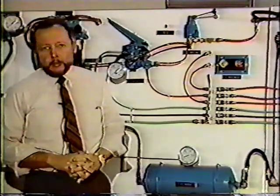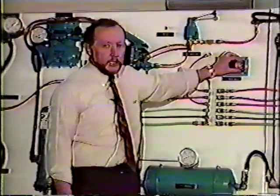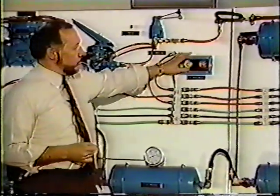That finishes the truck or school bus portion of the program. To turn this vehicle here now into a tractor, as far as the air brake system is concerned, we have to add one more particular system, and that is our red button, our PP7, or our trailer charge system. It works in conjunction with our yellow button, our park control system.